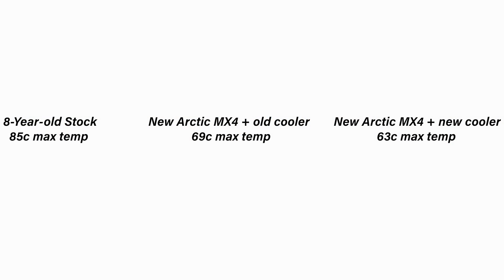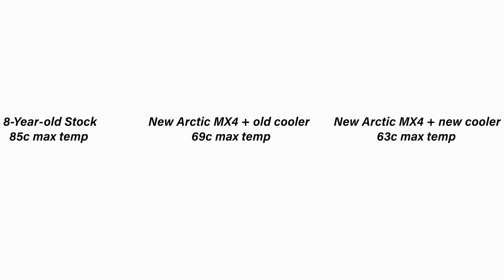TLDR time: eight-year-old thermal paste is definitely not going to be performing well. Sure it wasn't overheating in a vacuum, but when we compared it to good quality thermal paste like Arctic MX4, we saw a massive difference — a 16 degree Celsius decrease for just $9. If you also upgrade from an all-aluminium cooler to one with a copper slug, you not only get lower temperatures but reduced cool-down times as well. Whether you're running an older system for office tasks or a first or second-gen Intel i7, i5, or even an AMD chip, there's a lot to be gained from simply switching dried-up thermal paste to something that's still fresh.